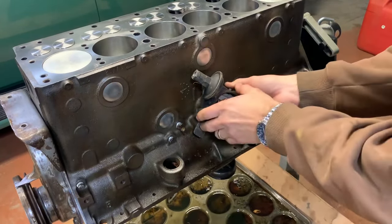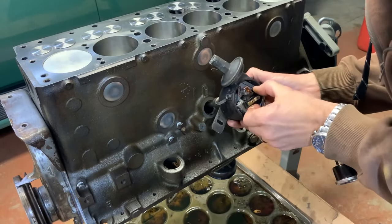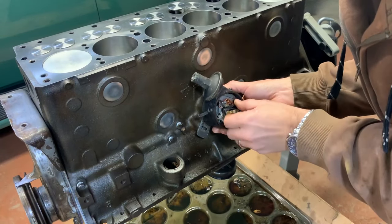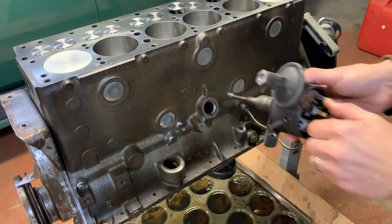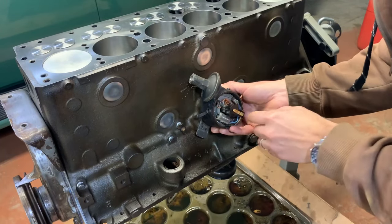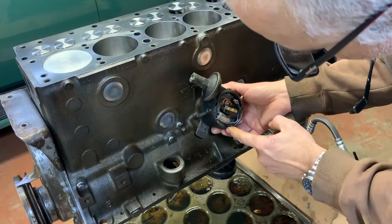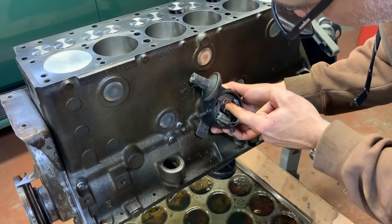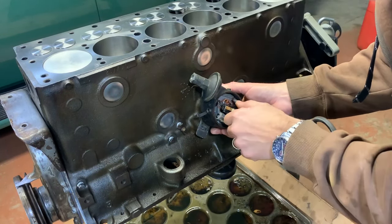So what I did is I took my oil pump out, I twisted it to the next tooth. And now, when I'm spinning the rotor here, all I'm doing is turning the shaft to line it up with the slot in the oil pump. I'm way up here now, 180 degrees that way. When I took it out, it was down here. So I'm gonna go back. I guess I was real close. I guess I did mark it right in the center. Maybe I was right on the edge, but either way, my number one was down here, and that's where I'm gonna put it back to.